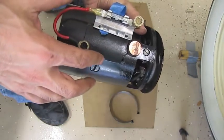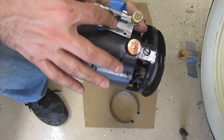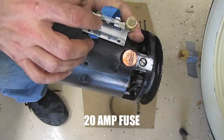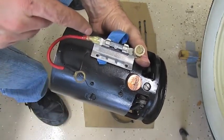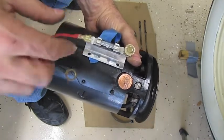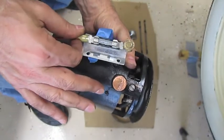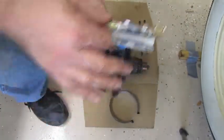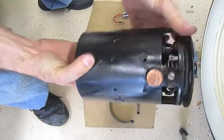The inline fuse is a small fuse — I forget the amperage, maybe 10 amp — and it sits in-line so if your wires ever get overheated or overloaded in your electrical system, this will go out before things start melting, which I have had happen in the past. It's not fun.